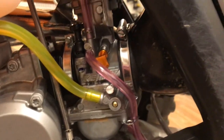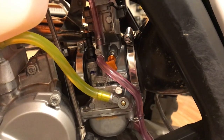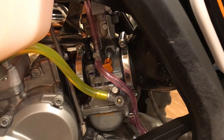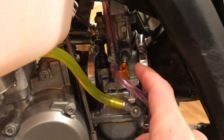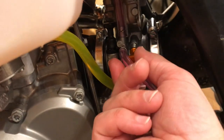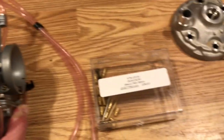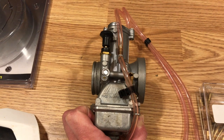One of the major changes I've made is changing the carburetor on the bike. The 2017 and 2018 KTMs come with a Mikuni carburetor, but I bought this Keihin PWK 38mm Air Striker — a short-body carb to fit the KTM — from JD Jetting. This carburetor comes with the JD Jet Kit, and I got the air screw and idle adjustment screw from Slavens Racing; these allow you to adjust those settings by hand without needing a screwdriver. Here's the original Mikuni TMX carburetor that came on the bike. I bought the JD Jet Kit for it and worked with it for a while trying to get it just right, but I really wasn't happy with the performance overall.